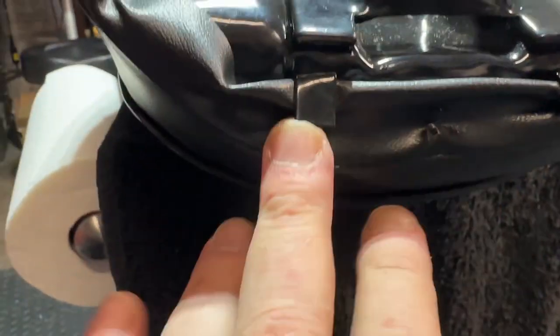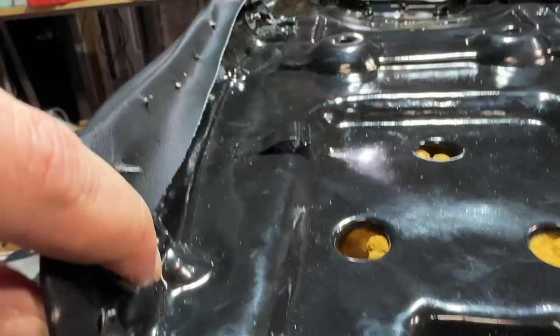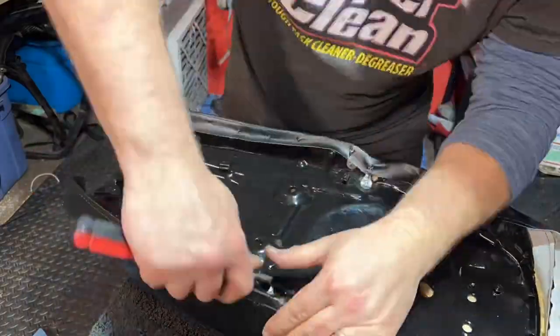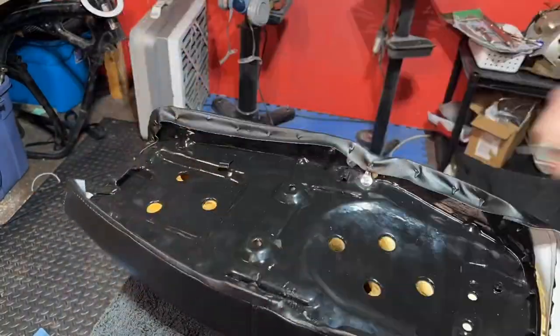These tabs came up and held on the front end. I like the way that front looks — it's right on that edge. Now we've got to start working the corners. I can't emphasize it enough — just slow and steady. This is really tedious, and you've got to be checking side to side, watching those seams. Just trying to get this line as straight as possible. Right now I'm pretty pleased with how this is going — I'm nice and centered, and I've got my front end all battened down. I'm going to bend all of these tabs down the row, then work on that back end, one mounting point at a time.